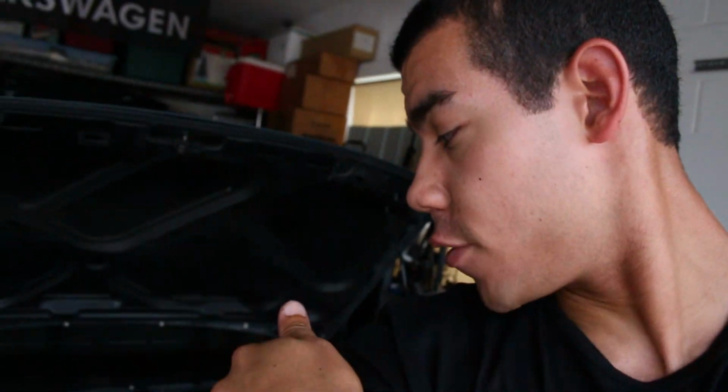All right, so all I have left at this point is to get the valve cover put back on, the upper intake manifold, and drill the hole in the side like I showed you earlier to put that little sensor piece. That's the only part that I'm kind of worried about. Once I pull it, I'm gonna measure which drill bit I need. And then I need some epoxy to glue it in. So I'm gonna go to the parts store and grab some of that.